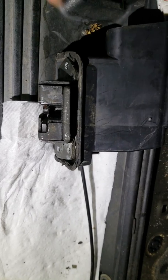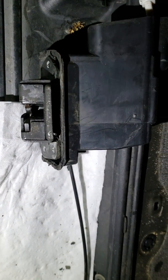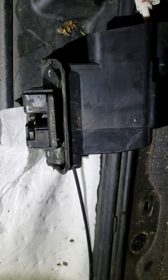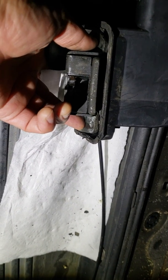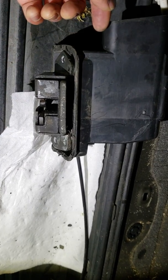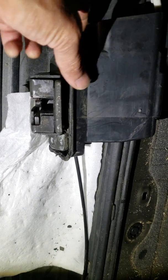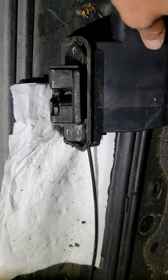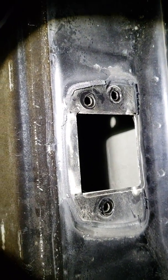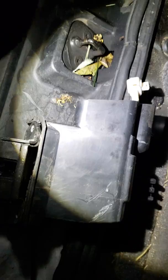I hope this helps. Sorry I couldn't remove this to show you what that looks like, but you'll be able to see it once you remove these screws from behind and pull this off. This will still be attached to the tailgate with three bolts, which you won't be able to reach until it's open. But once you push that mechanism it'll open, and then you can go underneath and remove the bolts that attach it — three bolts — and then it'll come right off. Alright, hope it helps, thanks.